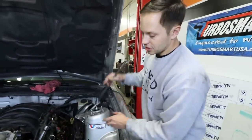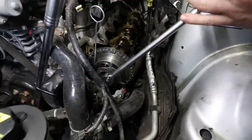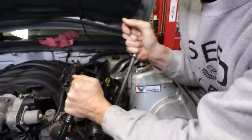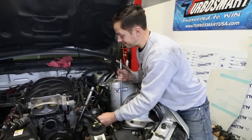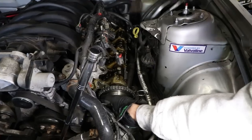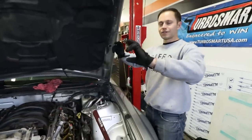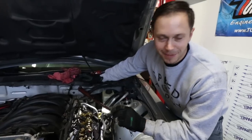The next step is to crack this loose and separate our actual gear from our bump stick. I've already gone ahead and somewhat secured our crank pulley — this is going to prevent the engine from rotating, and don't ask how we learned that the hard way. Got the phaser bolt out now. You just wiggle it off, though the cam always loves to spin on us — it moved a bit. Once you pop it off the tension loosens and it goes to the path of least resistance on one of the high ramp lobes. As long as the chain doesn't move, we're all good.